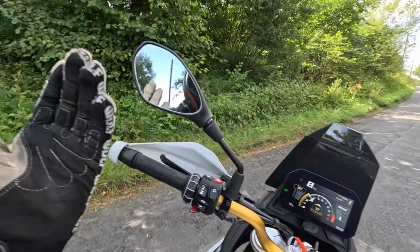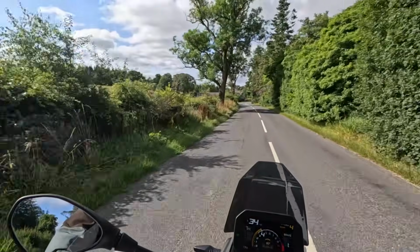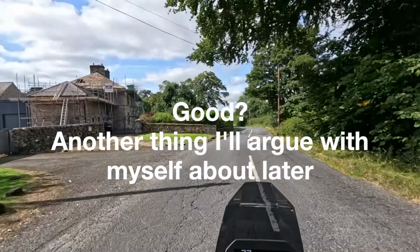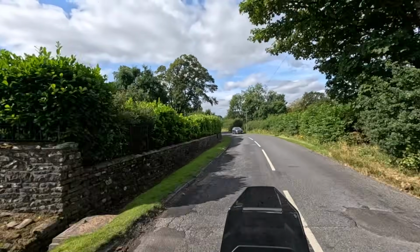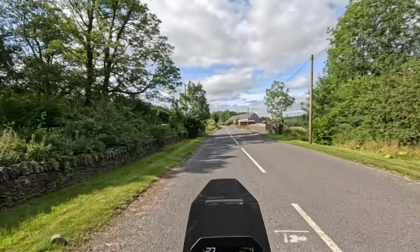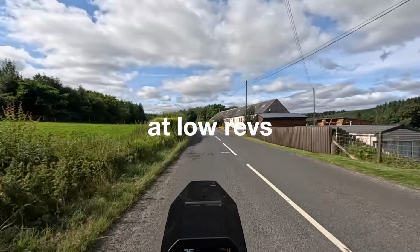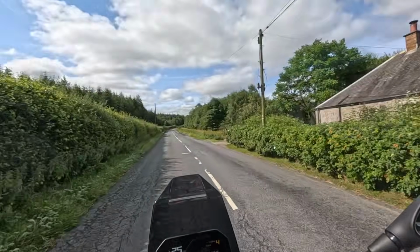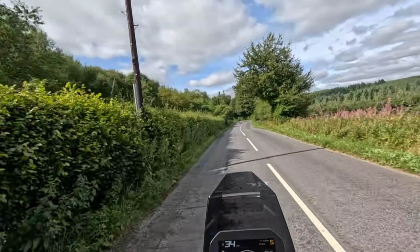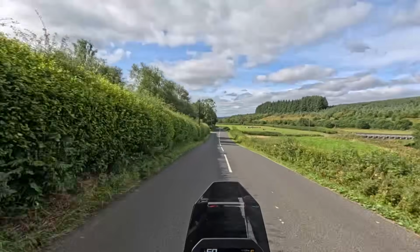With no clutch. That's all no clutchness. Lovely. It's a good job that the quick shifter is as good as it is. You really want that. You want to get that first to second change, and a lot of quick shifters are not really good enough for first to second. They're fine after that, but first to second's just too much of a clunk. But this manages it very well. It's not dealing with a load of power, and should do. It is a conventional clutch, and you can use that clutch. For the easy ride clutch to work properly, you want a good quick shifter as well. All in all, it's very impressive.